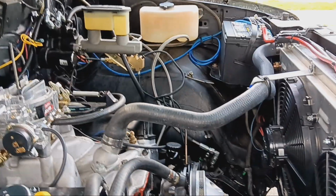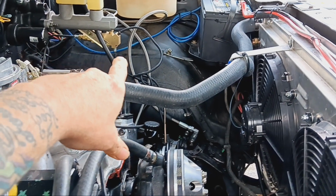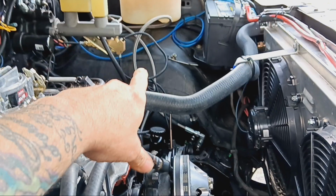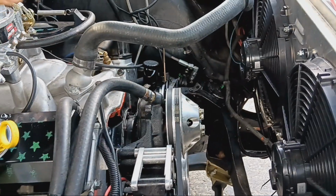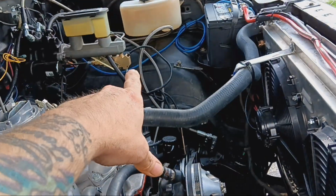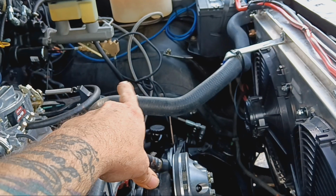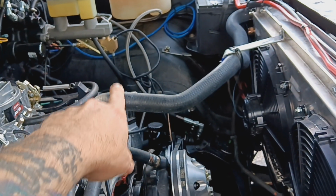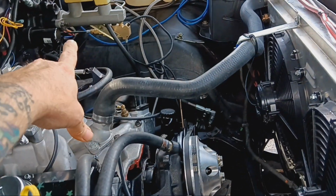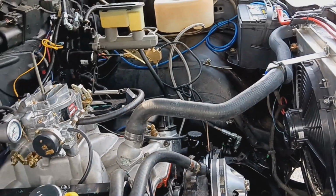So that works. And then I've got to redo those two brake lines right there. Those are just temporary. One of them, as you can see, is all bent. Because when I would sit up here, I would sit on the core support and put my feet down here on the frame rails. When I put the heads back on the intake and all that, it was easier on me to do it than leaning over this thing. And I leaned my knee over there and just bent those all to hell. So I just pushed them out of the way. So I got to redo them. I got some new line. I'll redo them, put some coils in them, and put them over against the fender or back underneath the master and down around the steering column and rerun them down to each front frame fitting where the soft hoses are at to where these hoses are.